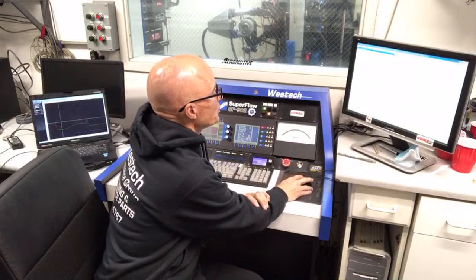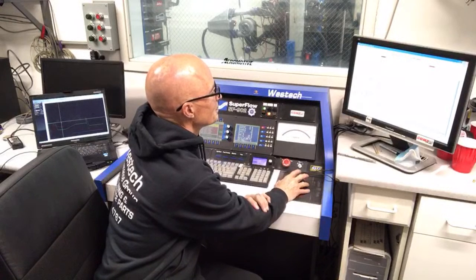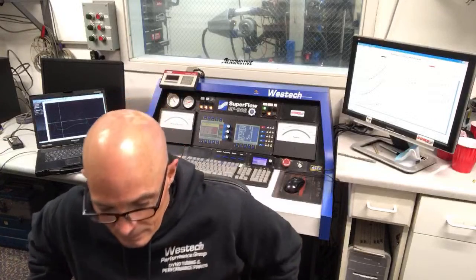So where do we think that this one would have gone to? It didn't look like the boost was stopping. I don't know what the maximum of the gate was going to be, but it would have been a lot. I don't remember measuring back pressure on this. I can't imagine that there's very much. It's got 3-inch tubing on it, and it's a pretty big turbo for this size combination. How much difference is going from a 110 centerline to a 114? It's a loaded question. It depends on what application and what you're doing and what everything else is.